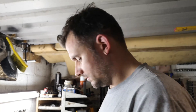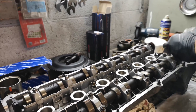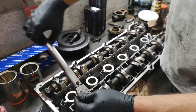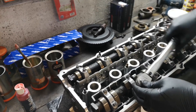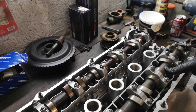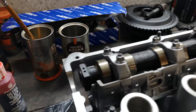It's nearly eight o'clock on Thursday night. I'm just finishing putting the cams into the cylinder head before I put the head on the car. I've done this to let the lifter trays bleed down first. The cam I'm working with now is a bit odd - this is the M50B25 exhaust cam, but it's actually an intake cam which I'm using as an exhaust. So finally what we have here is the M54 intake cam on this side and the M50B25 exhaust cam on this side.